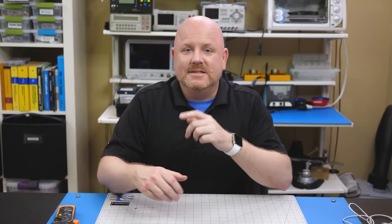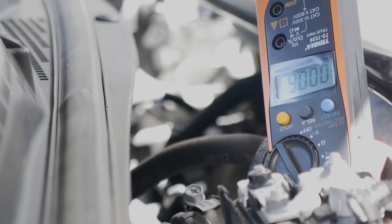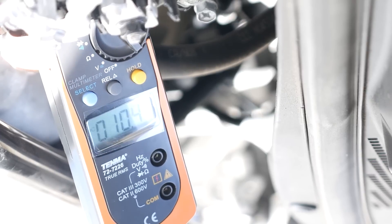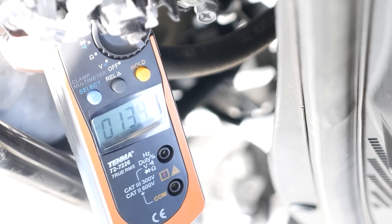Before I start the engine, there are two things I need to mention. First, remember that these clamps need the wire to be in the center of the clamp area — as a one-person show, I can't achieve that and start the car at the same time. Second, this meter does not have a min-max function; it can hold a measurement, but it can't detect and display the maximum. So I pointed a camera at the screen, and to make it easier to see, I will flip it around. When the engine starts, the current jumps and then settles around 10 amps. Because the sequence was so fast, let's watch it again in slow motion.